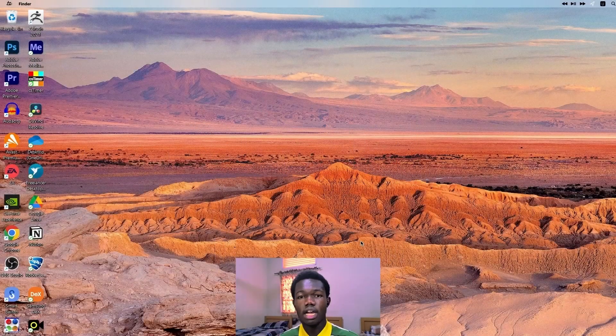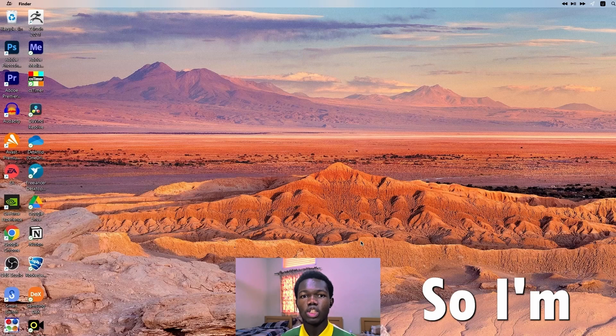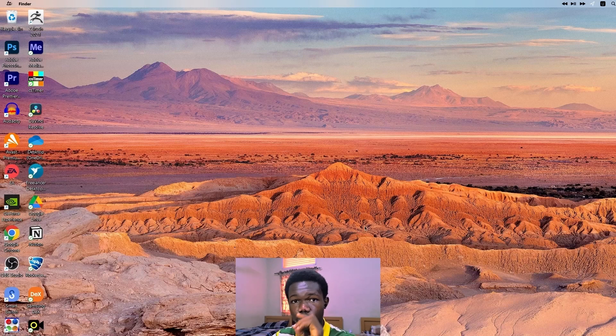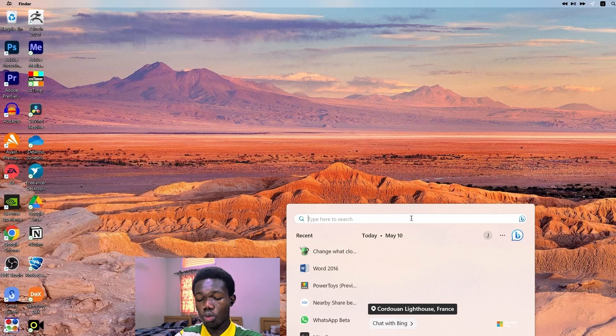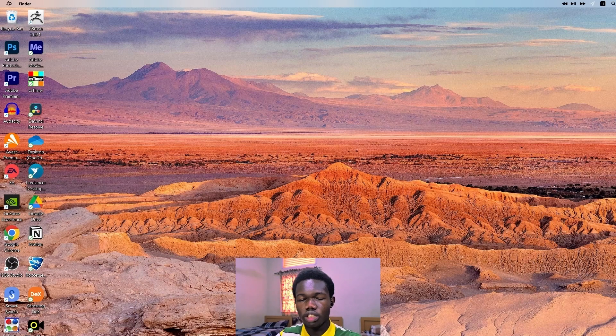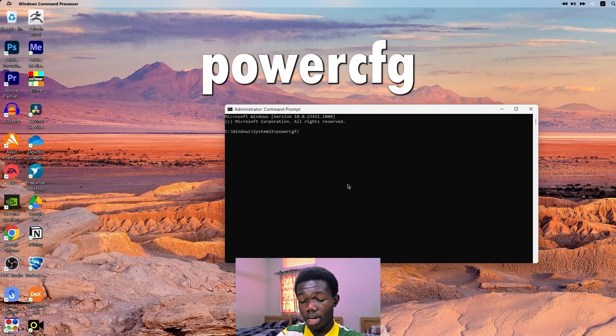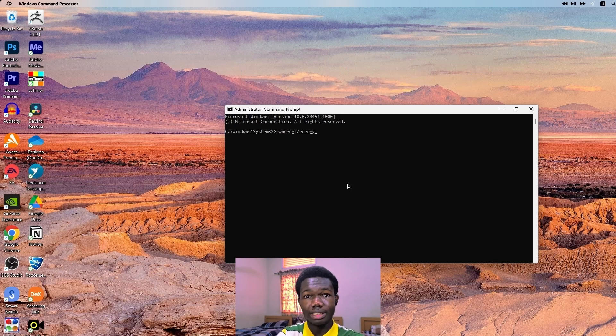Once you've done that and your laptop is still not charging, go to the next step. This next solution is still software-based — we want to check whether your battery is having issues, degrading at an unprecedented rate, or needs repair or replacement. We're going to generate a battery report. Go to your laptop and search for CMD, then run it as administrator. Type in 'powercfg /energy' — I'll drop this in the description in case you're unsure what to type.